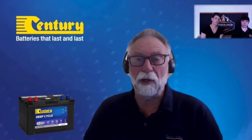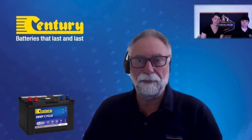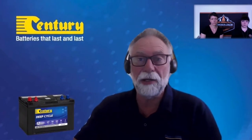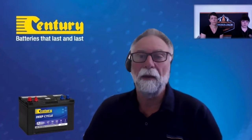Once you've charged the battery, let it rest and then recheck it to make sure it's fully charged — it's a resting number, not taken while the batteries are actually on charge. Most later-model chargers are staged chargers: they go from a bulk or boost charge to a maintenance charge, then just sit in maintenance mode when the batteries are fully charged.